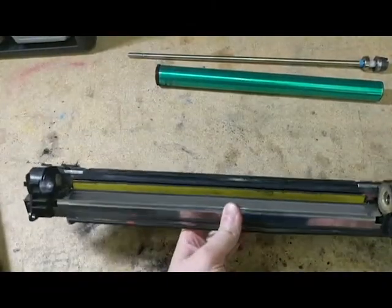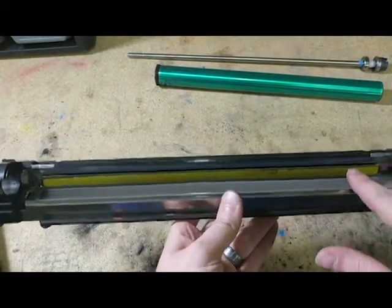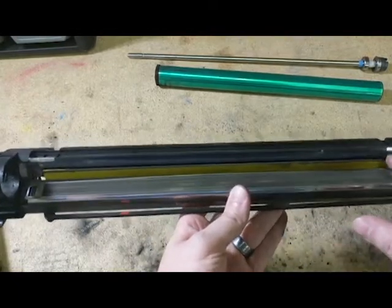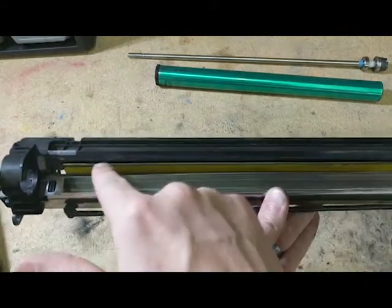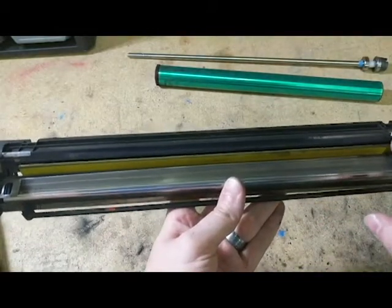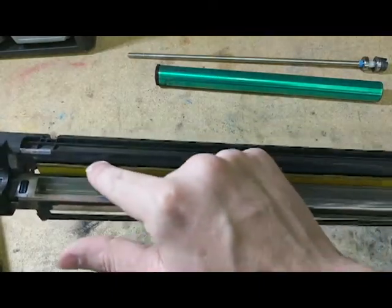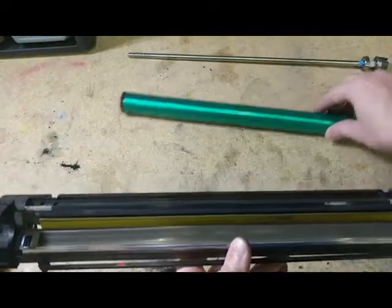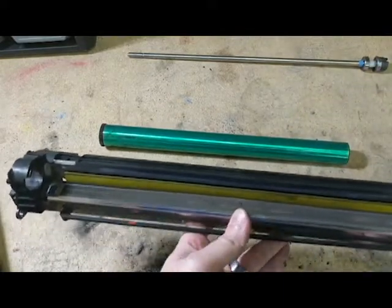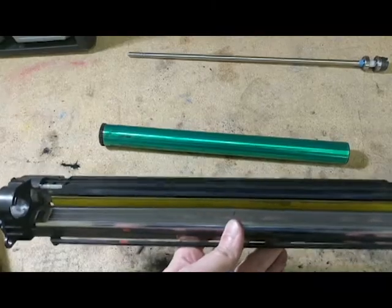Now that we have this apart, let's look at the drum side. You can see right here where it looks kind of yellowish — that's the drum blade, and you can look at one of my other videos to learn how to clean that. I'm just going to take a quick look along the edge and make sure it's nice and clean — no tears, scrapes, or cuts in it. Most importantly, I want to make sure that none of this developer or toner has hardened on the end. If something has gotten hard or crusty on there, it's going to roll against the drum unit in the same spot and eventually make a scratch in the drum. That scratch you can never repair and you'll have to replace the whole drum unit. You'll notice lines across your paper if that happens.